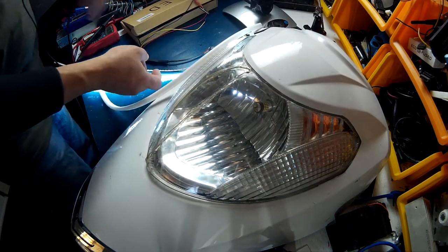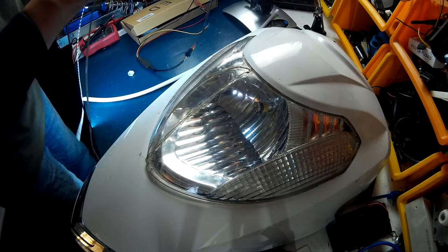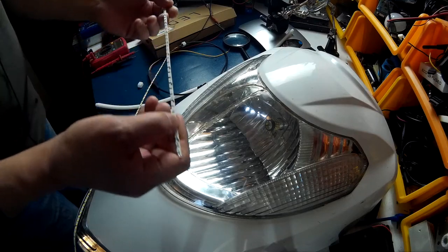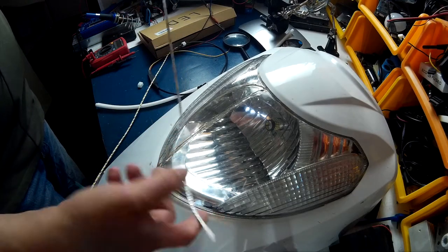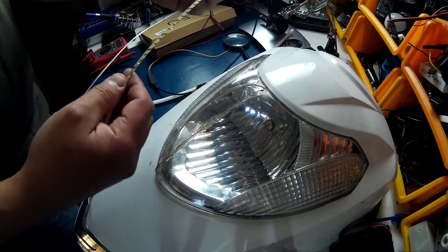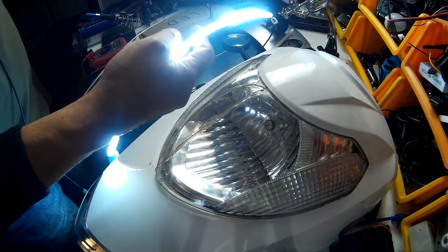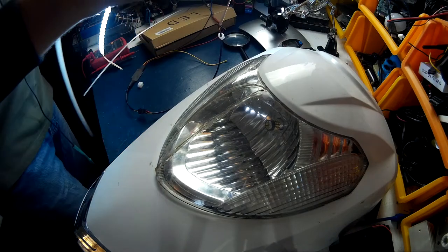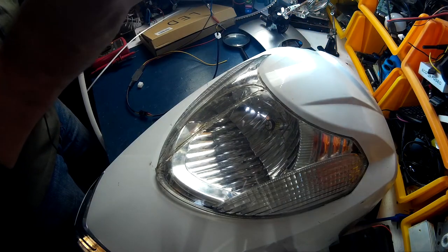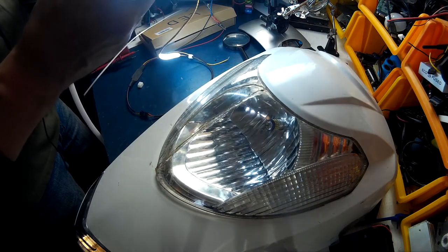If we lose the orange out of the strand here, it won't be so tight. I'll take a look at that, see if I can desolder it. Well, I desoldered the orange side. Not bad. It's one resistor per two LEDs, which is pretty good. This is the white side. Really, really thick LEDs. Pretty bright, too. I'm going to see if I can put it back in the tube. Now, from what I just checked, I'm pretty sure it can't go this way because it's too thick. It won't really show. Well, it might work.